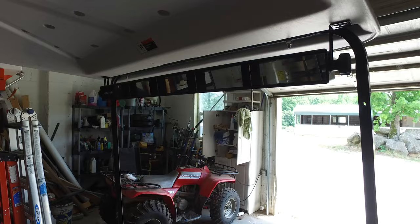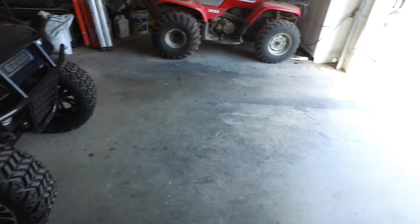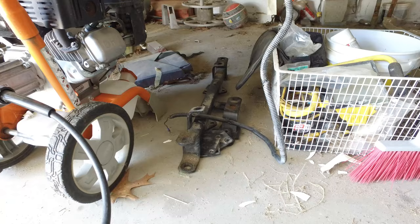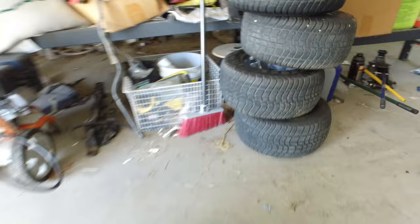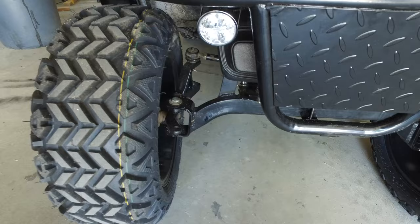I did install a six-inch lift kit — you can see the cart sits six inches higher than the factory install. Looking at the old front frame, the lower arm was straight all the way across with shock mounts on top and wheel mounts on the side. There were extra plates that came with it. The new frame shows the six-inch drop, and you can also see the steering strut extensions in the back at the original height for the kit.